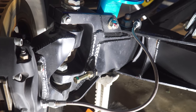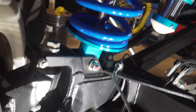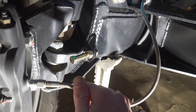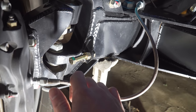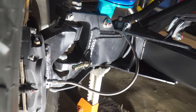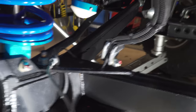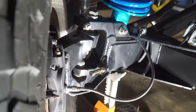We're currently at the front of the truck — this is the driver's side beam. We also have our King 3.5-inch bypass up here. Looking at the back side of the beam you can see our current steering stop setup: we have a tab coming off the beam with a bolt and two nuts to keep it in place. Right now the truck's at full lock to the right, but as it comes around to the left this spindle will come in contact with the bolt head and stop the spindle from rotating anymore. This bolt setup seems pretty common on a lot of off-road trucks. The one downside is only one side of the truck is stopping the steering — nothing on this side is stopping it, just the other side.